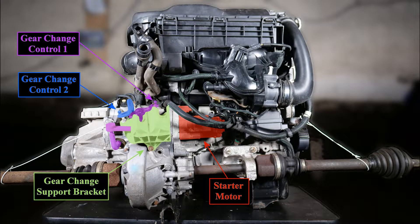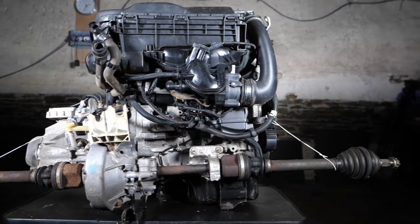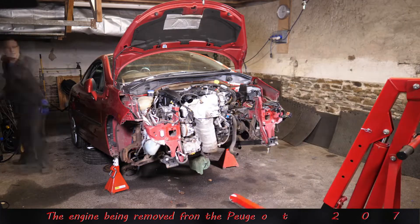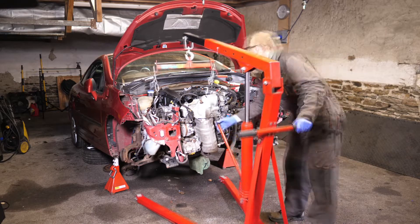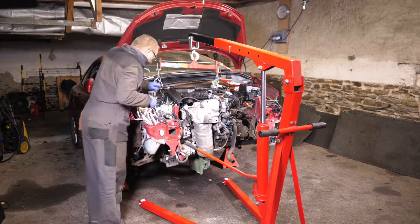Oil leaks were also an issue, possibly caused by lengthy oil service intervals degrading rubber parts due to increased acidity of heavily contaminated oil. The water pump idler pulley and associated rubber parts also wear out, causing undulations in the rubber surfaces requiring replacement. Thermostats with built-in heaters are also known to have issues resulting in overheating and underheating, with some lasting only 30,000 miles — some showing the wrong temperature, causing the ECU to set the wrong air-to-fuel mixture. The rubber membrane in the crankcase ventilation can also fail, resulting in air leaking into the intake and causing the engine to run unevenly. There have also been several recalls on the high-pressure fuel pump, which is driven by the camshaft.